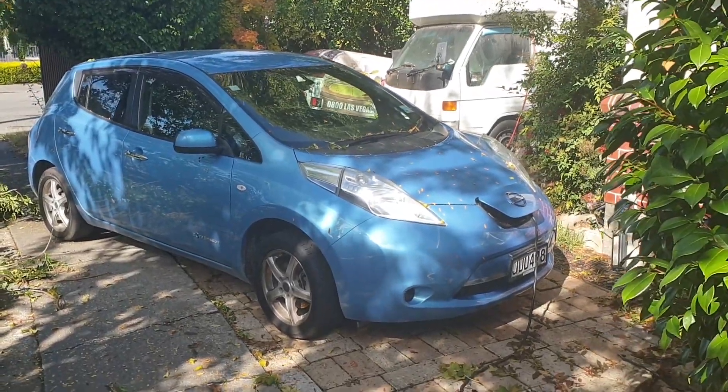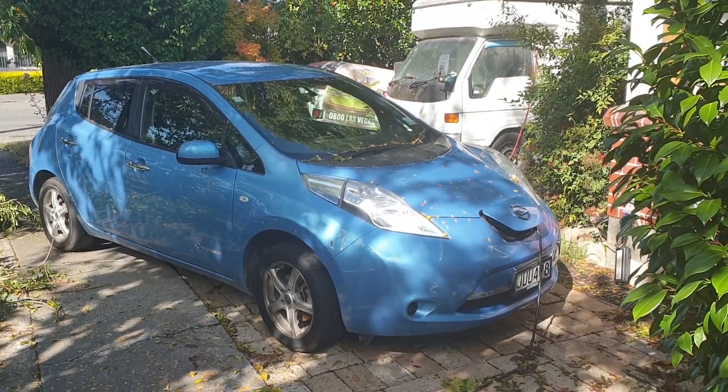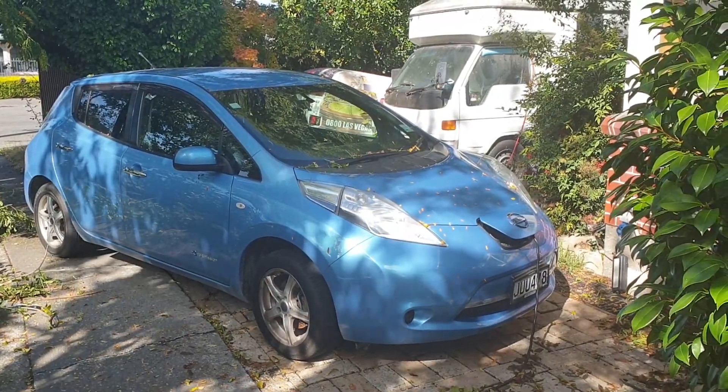One of the things you don't want to do is leave your car plugged in if it's not charging. By all means charge it when it needs to be charged, but once it's done charging, take out the plug. What happens is that the car will stay on to monitor the status of the charging, even if there's no charge currently being received. Having the car constantly plugged in means that the 12 volt battery is constantly draining to monitor that connector being plugged in, so you basically end up with a flat battery.